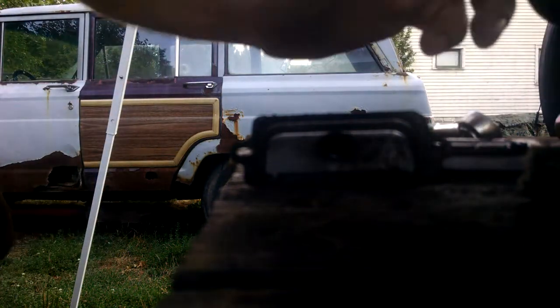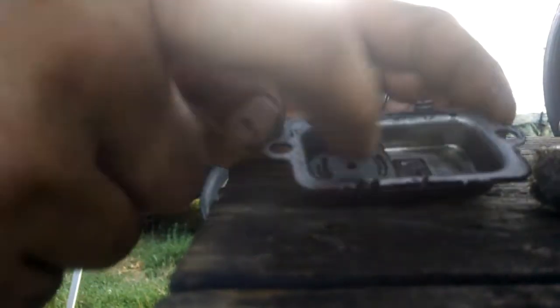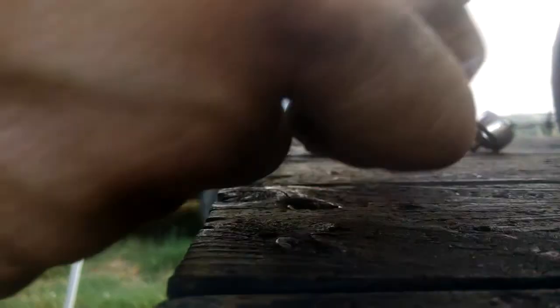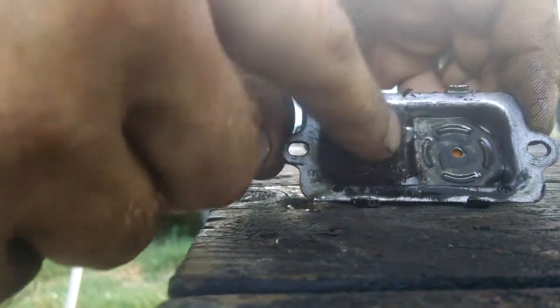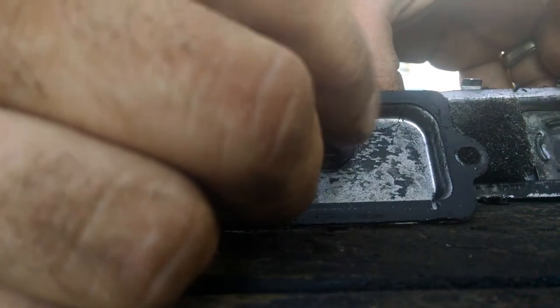Instead of baffling, it's just got a little sponge in there for the oil-air separator, and you've got your one-way check valve. It enters through here, goes through the sponge, separates the oil and the air — the oil stays at the bottom. There's the bottom with the two little holes. On this part the air is going to be on top, so that's why this exits from the top and the air exits.